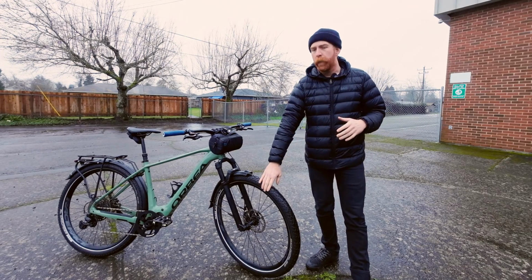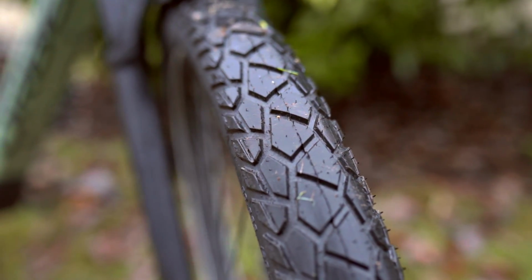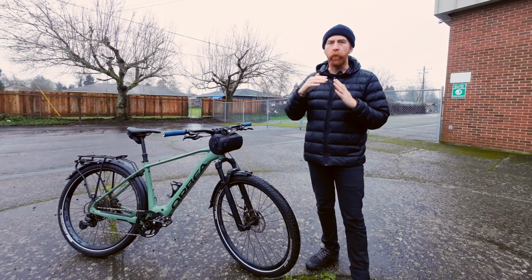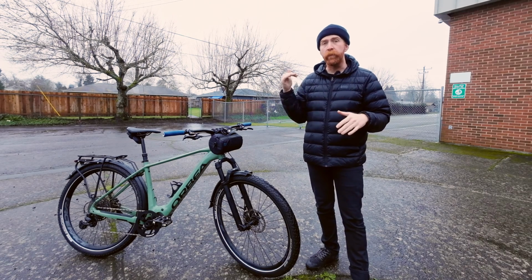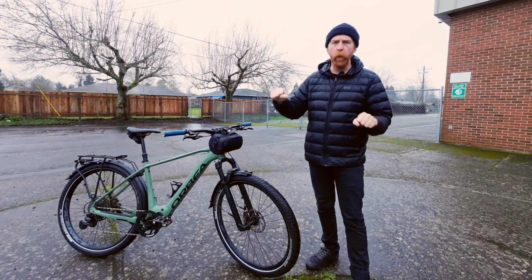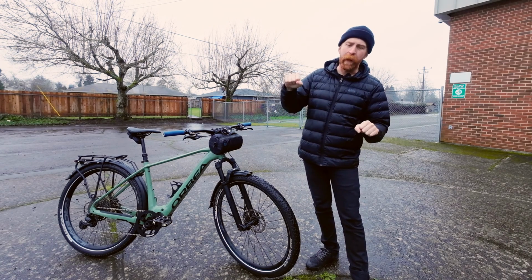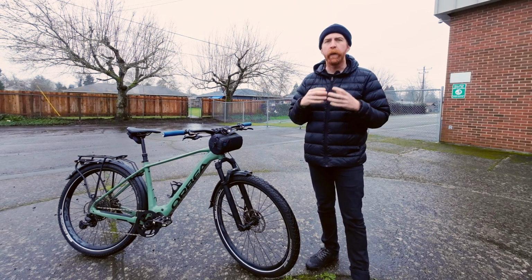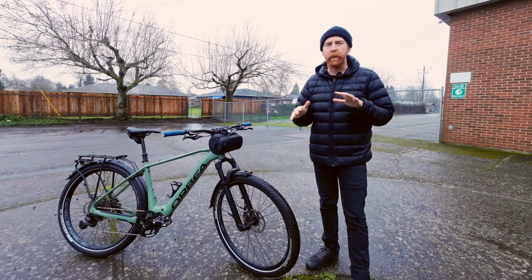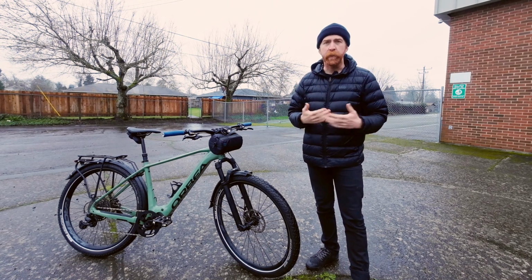They're gonna have a more evenly distributed tread pattern, wider on the tire. There's not going to be as much of a shelf or a float zone like a knobby tire would have. So when you're cornering, going fast downhill, the float zone is not when you're upright, and it's not quite fully in that corner. It's right in between, that float. Having a shallower pattern, that wider tread pattern design on there is going to allow you to smoothly step into those corners, especially when you're going faster and at speed.